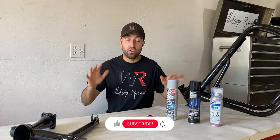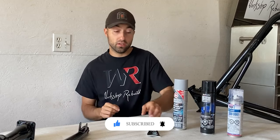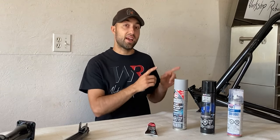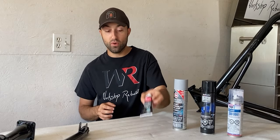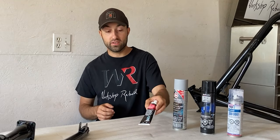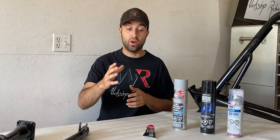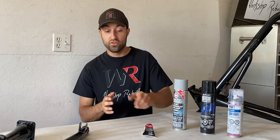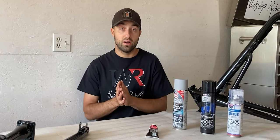I hope you enjoyed the final finish on all these motorcycle parts. Now my honest opinion on the paint products: the spot and glazing putty — I used this to fill in dings and scratches on the frame, swing arm, and rear frame assembly. It works super well if you apply it thin, dries in 20 to 30 minutes, and you can sand it down and lay down your primer. It's very inexpensive at around $10. You could also use a very fine Bondo as an alternative, just don't use too much if the scratches are very fine.